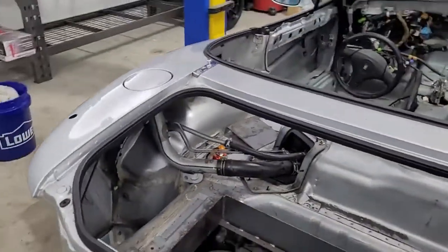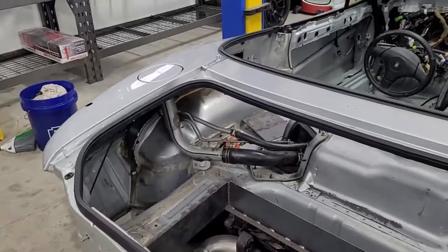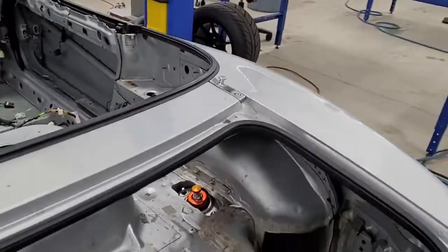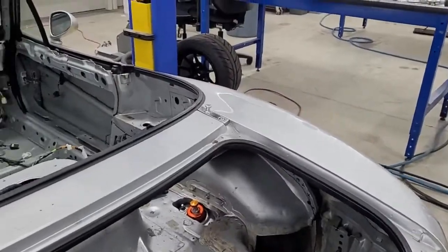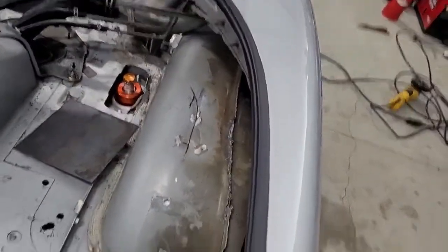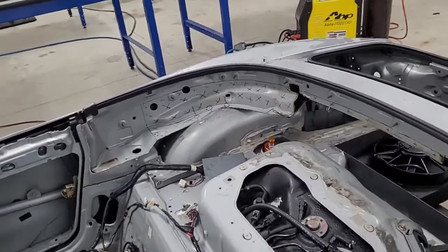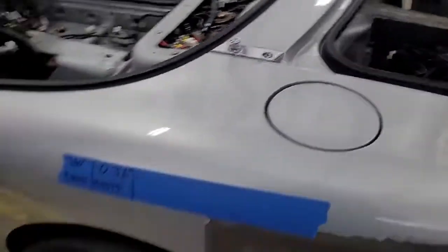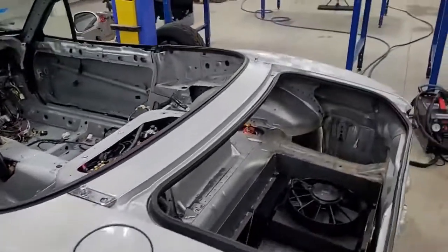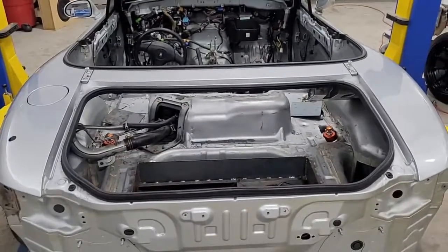I don't even know how to get in there and cut it — some of that metal is close to the outside skin of the car. I can't just turn the plasma cutter on and rip it because I might skim right through the sheet metal on the outside. So it's probably going to have to be done with a Dremel or something. I haven't really got a good plan — that's why I stopped. Problem for future Pat. Good progress, we're going to keep going. We've got to finish cutting the metal out over here, do all that work again on this side, and still cut the top of the fenders out. I'm starting to lean more and more towards making the cuts bigger and putting an even bigger section to replace it. We want to make sure that whatever we put in there, we're not going to have to go back and redo it. For example, out here we only have an inch of clearance, but I might give it more on the wheel wells so that if I end up needing more down the road, I only have to cut the outside — the inside's already big enough. Anyway, I've been rambling long enough. Till next time, take it easy.